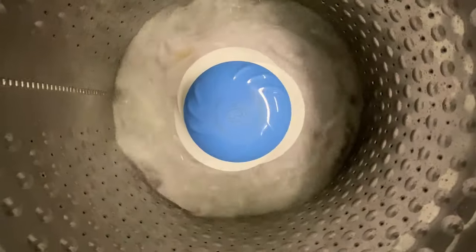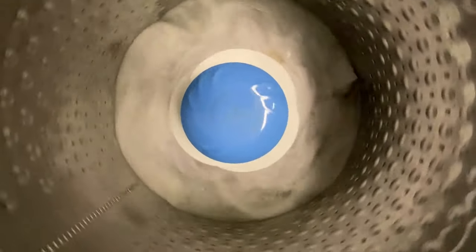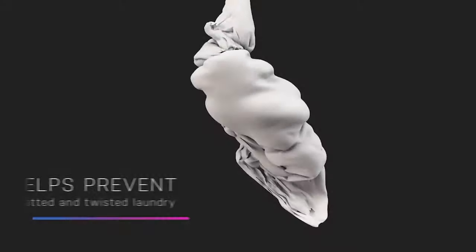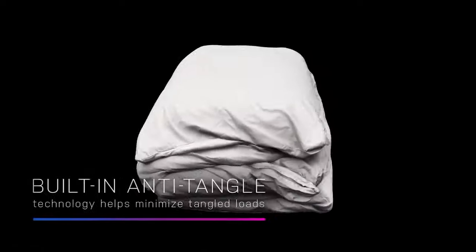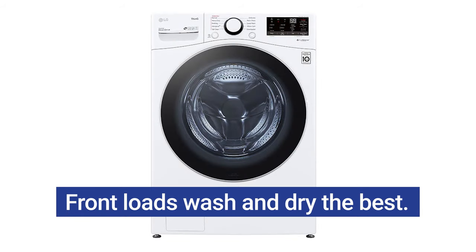Even though front load washers spin faster, they're also gentler on your clothes because the clothes effectively wash themselves by rubbing against each other in the wash cycle. Top load washers are tougher on clothing because of the agitator. Oftentimes the clothes can be knotted around the agitator in my top load. Well, this never happened in my front load I had in the previous 20 years. Interesting, the new GE Profile Hybrid top load has a knot cycle to prevent knots from occurring. So from a washing and drying standpoint, a front load will wash and dry better.